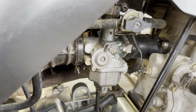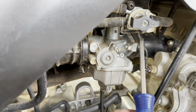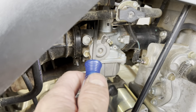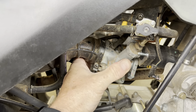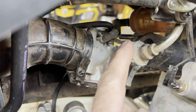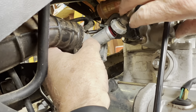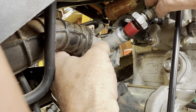Our plan is to rotate the carburetor out this way. We're going to take these two nuts off — there's one here and one on the other side — then loosen this squeeze clamp up here so we can rotate the carburetor and get up to the top where we can access it. We spin this off right here. Okay, we got it spun off — oh look at that, there it is, the infamous red spacer!